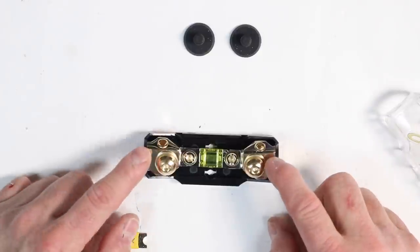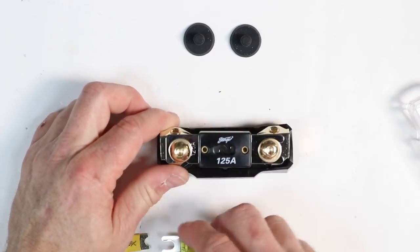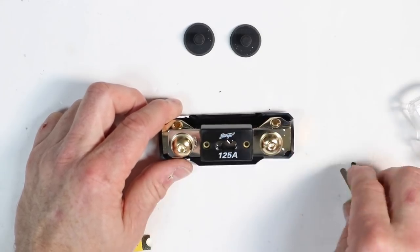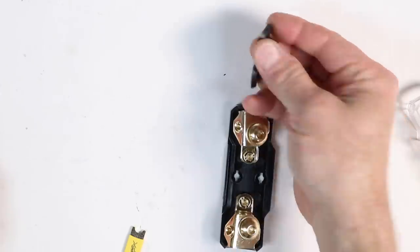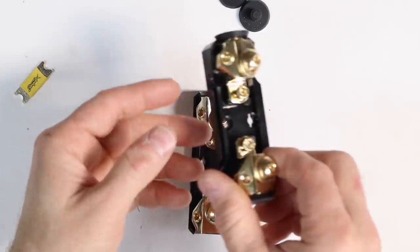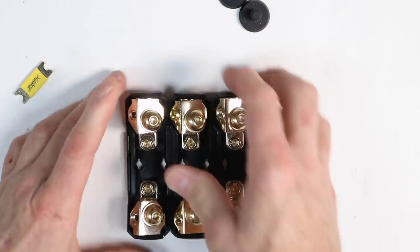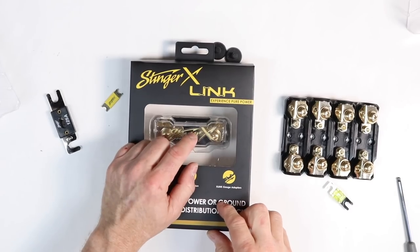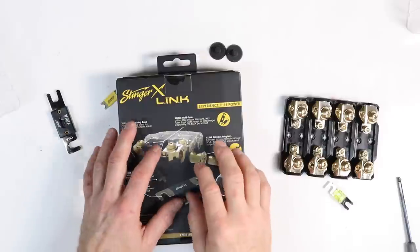Around the ends there are covers you can pull out. Inside is a 175-amp mini ANL fuse. But notice these two bolts on the outside — they're there because you can actually use a full-size ANL fuse if you'd like. So if a mini fuse blows and you can't find a replacement, you can switch to the full-size, or vice versa. There's more to this fuse holder, which is why it's called the 'link' and why it comes with these little plugs. On each side of the fuse holder you'll see grooves — you can take another one of these fuse holders and link them together, because you can buy just these fuse holders under the link brand.